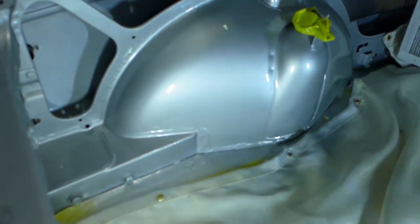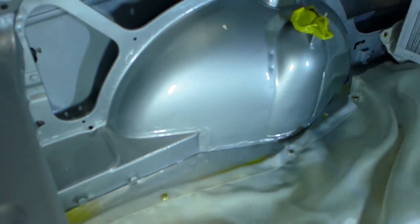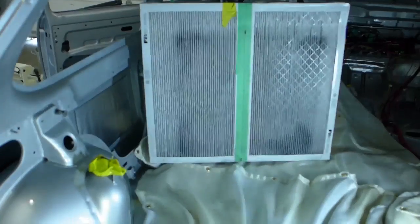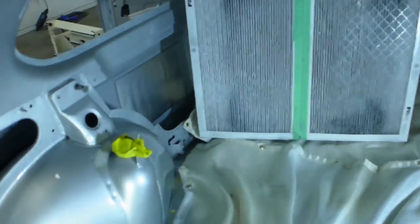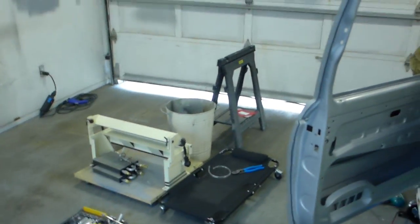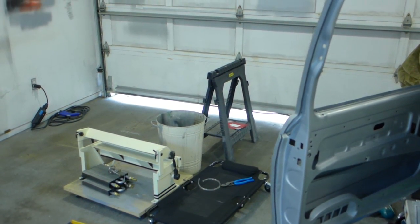It's a bit smelly — I just sprayed the silver and clear after grinding off the tabs. My technique when I have to spray is to filter the air right away, draw it away, and try to filter it before it gets all over the rest of the car. It's not perfect, but I do that and also have a portable filter pushing dirty air out and crack the garage door to bring fresh air in — just a cheap way of trying to clean the air.